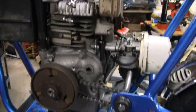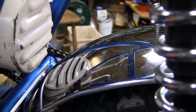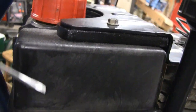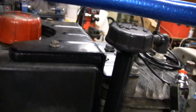We got you all bolted down. We got some tight clearances here. Look at back here — by the muffler, the intake. I got about a half inch, which is okay. Maybe a little less — three eighths. And up here I had to put a little spacer right here to lower my gas tank so I can get my cap off. But we got room to get the cap off now.